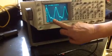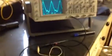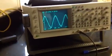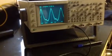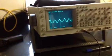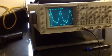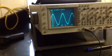And there's that term which we've all become familiar with at the bottom of this scope. What my son found earlier, which was quite interesting — if we pick the opposite number coil and put it in phase, we straighten the waveform out. And in anti-phase, we get half and a ghost. It's the opposite number on the other side of the coil plate.